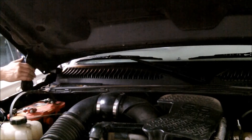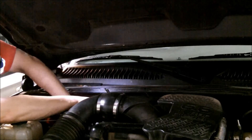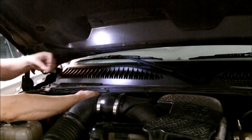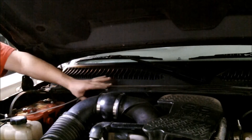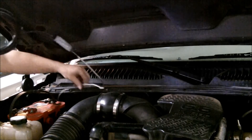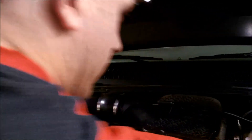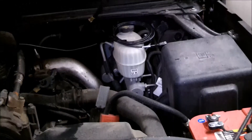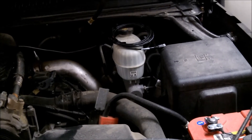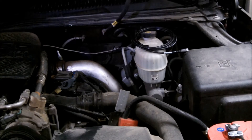Alright, so the pyro cable has come up right here, back behind the fuel filter. I'm trying to run it not where that piece of plastic is. I'm going to run it right along underneath here and find a way to clamp this off. The braided piece is going to get me across the engine — that's what we really want. Where this is going to feed, right there behind the brake master cylinder, is a boot that goes through the firewall into the cab. So that's where I'm going to take this in through, making sure it's through before I start tying it all down so I have any slack picked up on either end.